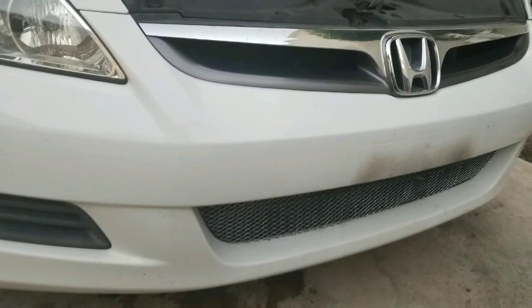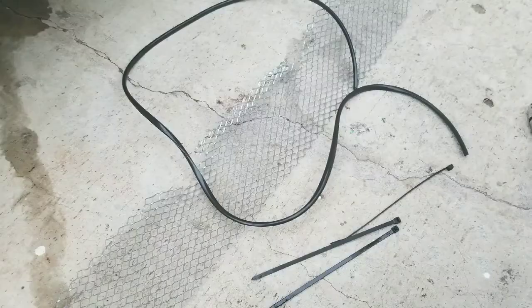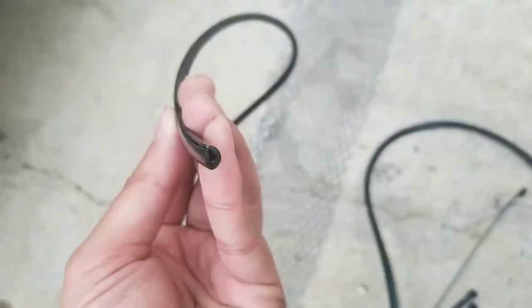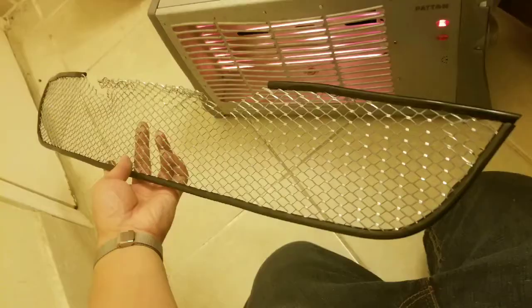Place it on top and mush it in — that's basically it. But to make sure it doesn't fall out while driving, I cut notches for the two bolts and got some zip ties and door edging material — those plastic door edge guards you can get on Amazon, link below. It needs to be softened first, so I put it in front of a small space heater to make it pliable. Then you run it along the edges of the entire screen so it won't scratch any paint. Cut it so it covers all the edges that touch painted surfaces.